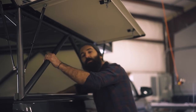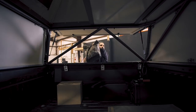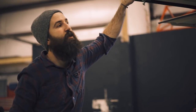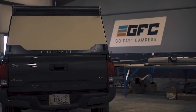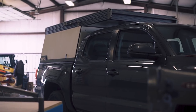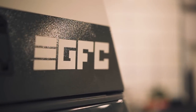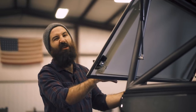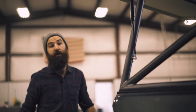Plenty of room to allow side access, so we can get in there and grab gear, store things. Aluminum panels on the outside seal to the space frame — it's all 5052 aluminum. Really good for corrosion resistance, but we also powder coat it, which helps a little bit thermally. We also put a stippled texture powder on this, so when you're dragging it into the trees you won't see scratches on a high gloss layer and it'll really shed everything pretty well and be easy to clean.